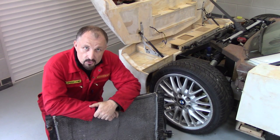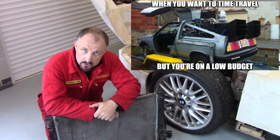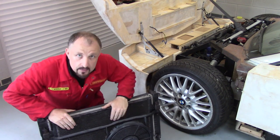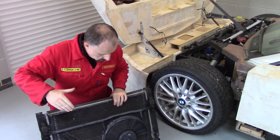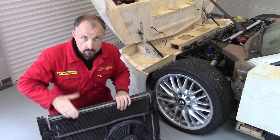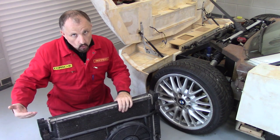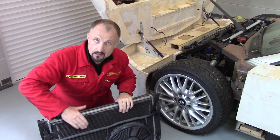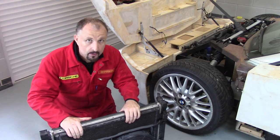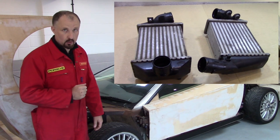They look great and will solve a whole load of problems. Unfortunately, it will add to the budget. There's another problem — this here is the condenser radiator for the air conditioning, which bolts into the OEM radiator. So an off-the-shelf OEM performance radiator isn't going to work. I'm going to have to get one custom made so the condenser can bolt to it, or get rid of this altogether and get a custom condenser radiator — but that also adds to the budget. So it looks like the steering rack, the intercoolers, and now the radiator aren't going to work on the turbo build.